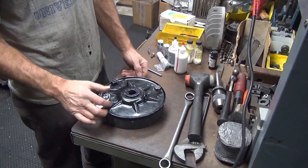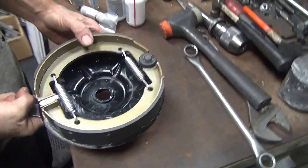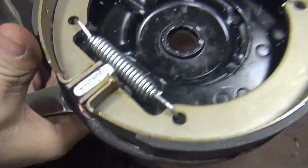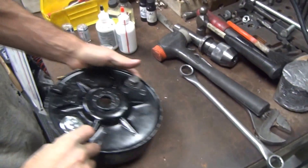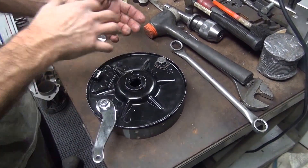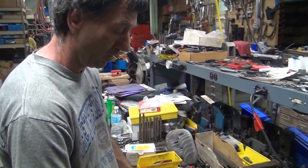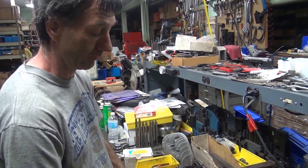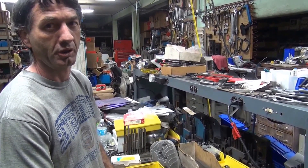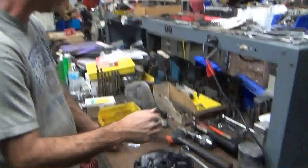This is just supposed to slam right together — obviously it didn't, so why would anything else be any better? Anyway, that's how you do it. That's what it looks like all buttoned up and done. Make sure you've got your arrow going out, and everything works smoothly — work the brake and it's all nice and smooth, nothing bottoms out. Next thing is to put it on the bike. I put it on the wheel with the drum on it, put the axle through it, the sleeve all out, just mock it up on the bench and make sure it all seems to fit together first before it goes on the bike. Because it's easier to deal with it right then, and then put it on the bike and check it again. All that stuff you've got to check — that's what makes it work the first time you go down the street, not every five minutes pulling over to fix it. Once it's fixed right the first time, it's fixed. So this is all done — we'll move on to the next thing.